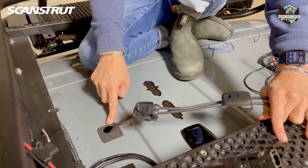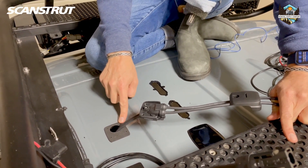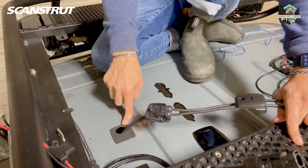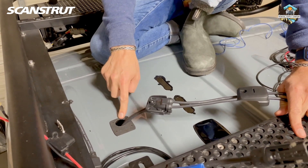Then you're going to put a minimum of two layers of rust-proof paint over all of your cut lines. Make sure you let that paint dry for at least six hours per coat and you sand it in between coats — no less than two coats.